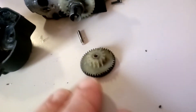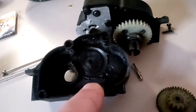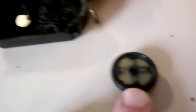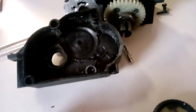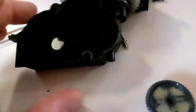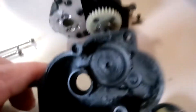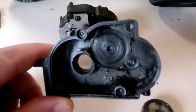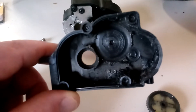This time it wasn't the motor that got hot to cause this burning into the side — it was just the friction from this spinning right up against the plastic wall with no bearing or anything, no washer, nothing keeping it off of the plastic wall there. So like I said, it's a poor design for anything that's going to have really any speed or power.